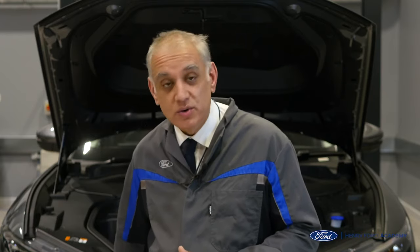Just remember, only use the front cover if it's been more than 48 hours and the door capacitors have become discharged. As a word of warning, connecting to the two wires via the towing eye cover only opens the frunk if the battery is discharged — so there's no scenario where a thief could walk down the road, energize someone's Mach-E and expect the frunk to open, because the battery will be charged and healthy. Thanks for watching and I hope you found this short video useful.